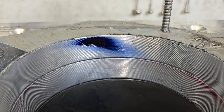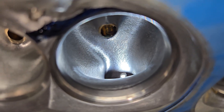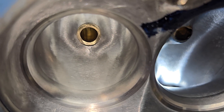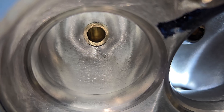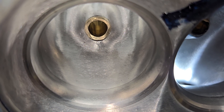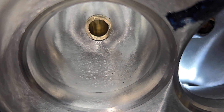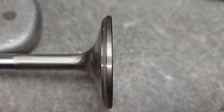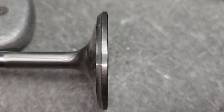Okay, not bad in the bore. At this point we're pretty much done where we need to be. The exhaust really didn't get any more work and I didn't re-flow it because it flowed plenty. You can see where I touched up around that guide a little bit but it's pretty much done and I think it's more than enough exhaust. I was thinking of putting a radius on the exhaust valve.